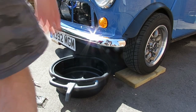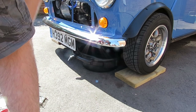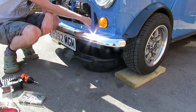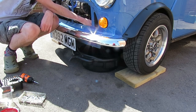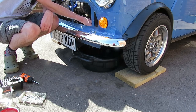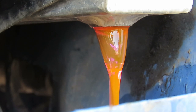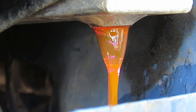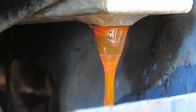If you're struggling to get access to the underside of the car, put it up on some wooden blocks — this will give you some extra clearance. What I'm doing is just undoing the little plug from the bottom of the radiator which will hopefully unleash the coolant. You can see little bits of it coming down now. To help the coolant flow through a bit easier, just take the radiator cap off — this allows air to work its way through and help the coolant come out of the bottom.